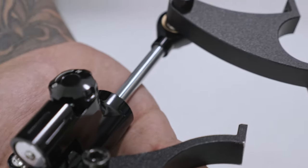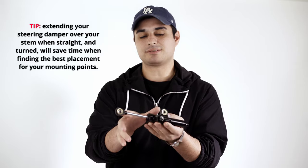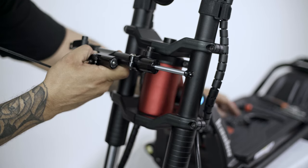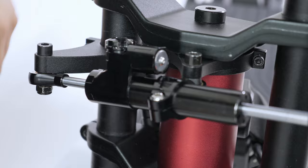Make sure both clamps are installed on the same side of the damper. When installing the steering damper on your scooter, it's important to make sure that you give it enough range for when you're going left and right and turning your stem. In order to do that, you'll need to measure the damper and make sure that it matches the mounting points when the stem is straight and when the stem is turned. We'll be attaching the larger clamp to the very top of the rotary head and the fin shaped clamp to the dual suspension tubes.